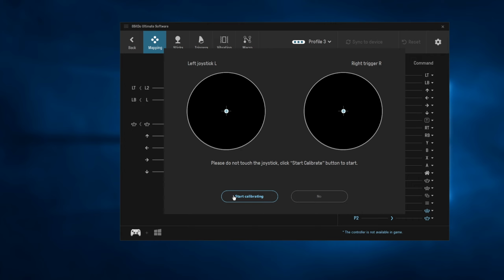If you have enough access area and the drift is not too big, this might actually work. But many third-party controllers have calibration tools that can mitigate this issue. A good calibration program renders this so-called permanent fix useless and unnecessary. However, none of that, including this mod, can fix a hardware limitation. Another thing is, if you're going to solder stuff anyway, just change your joystick potentiometer. Buy a lot of them. For $2 to $3 you can get at least 10 of them.